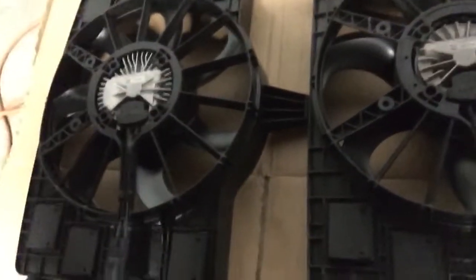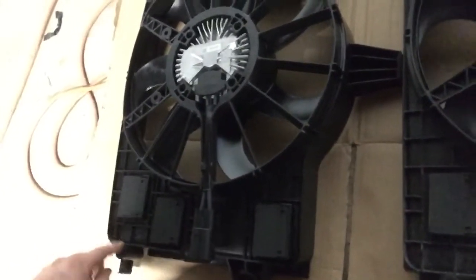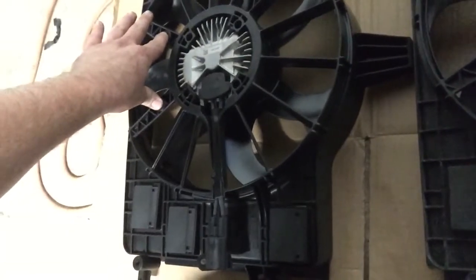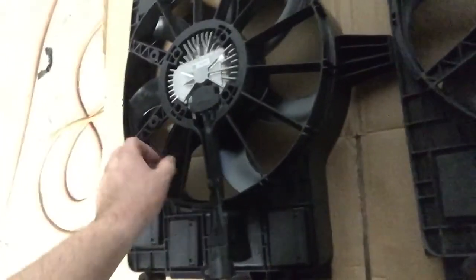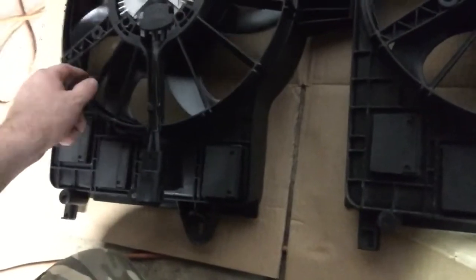Whenever you remove these fans, they're not too bad. You have a plug here that holds your wire harness — the harness clamps on here and plugs in. You've got two radiator plugs that hold in here, keepers for your radiator, and a cooling hose. We're going to go ahead and install the 600-watt unit — it has the exact same plugs, everything's the same. I'll have a link in the description to where you can purchase the 600-watt fan; it's actually quite a bit cheaper.